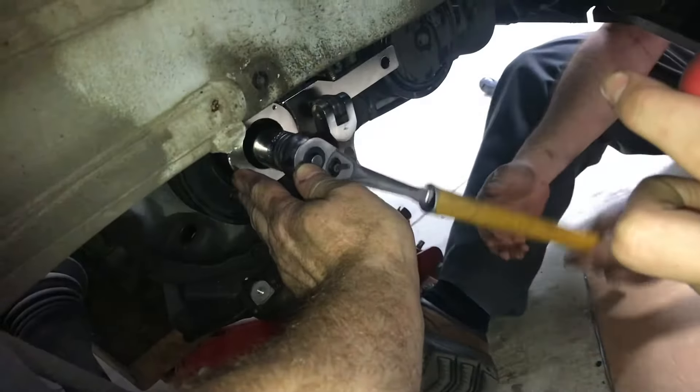This small plastic piece will allow us to take the bottom cover plate off. You'll want to pull the spark plugs out so you can turn the crank over more easily without compression. The timing chains have different colored links that line up with marks on the sprockets. If you look at a sprocket, you'll see a small triangle — these colored links line up with those triangles.